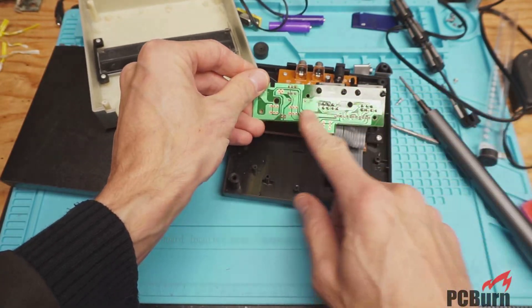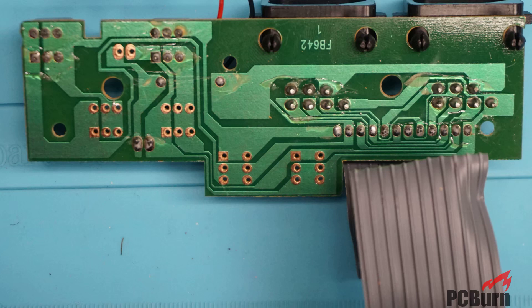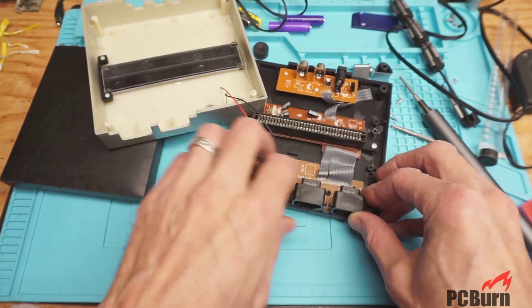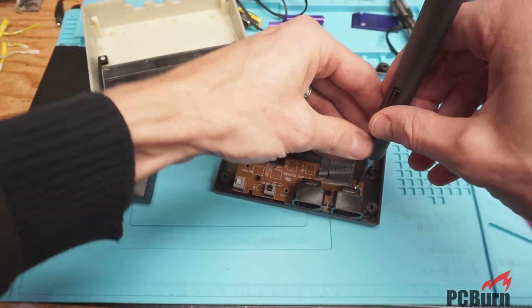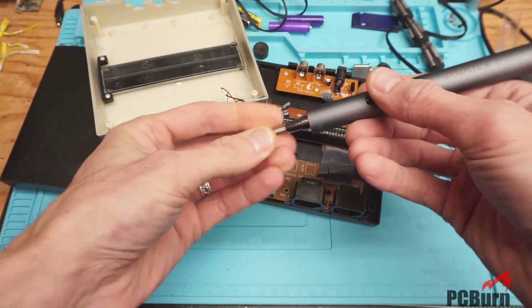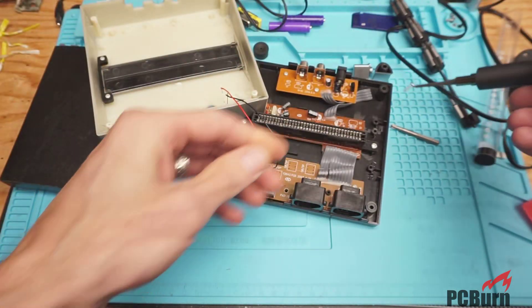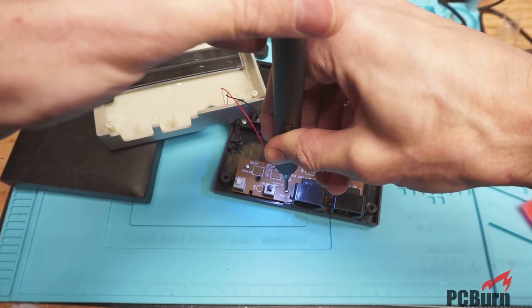There's nothing on the backside, just traces, as I supposed — these are extra slots for pins for both the LED and the switches, so you can populate it differently. Normally you wouldn't do that because it costs extra money to make a larger circuit board, but probably not too much. This brown board is generally not expensive when you purchase it on the open market for small quantities, so I'd assume it's also the cheapest in industry to get in quantity.